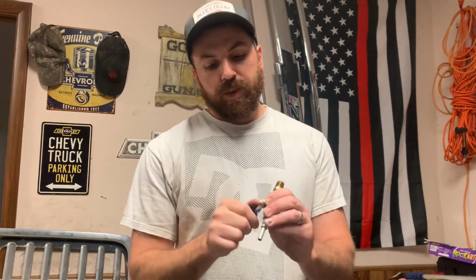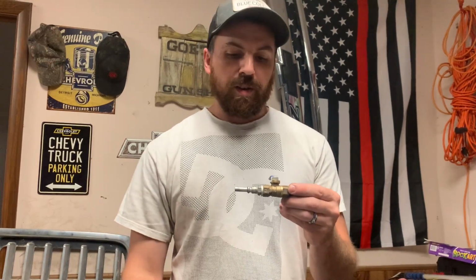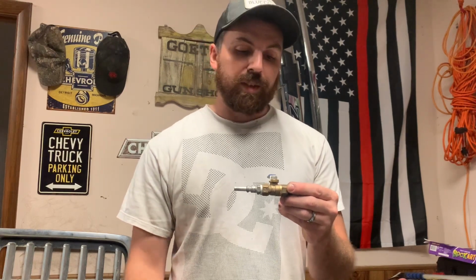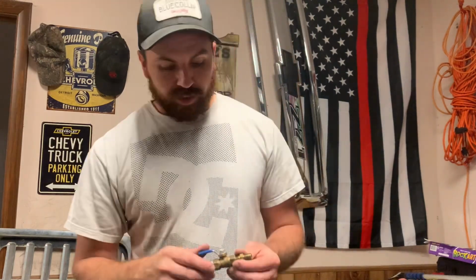Fun. Well, a couple tools like this come in real handy if you're working on the bigger trucks. This is basically just an air chuck stuck in some fittings. You can take a fitting out of the air tank, thread this in, got a ball valve on it. Basically hook it up, air it up, close the ball valve, pull the air hose off, and you got air to release the brakes. I've got a couple different styles of these made up. I've got one where you can pull the charge line off and hook air up and air it up that way, and then pull it off, and then, you know, it's going through the air dryer and all that, so air doesn't gush back out. Stuff like this is handy to have in your toolbox, and easy to make out of stuff just laying around the shop.